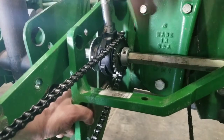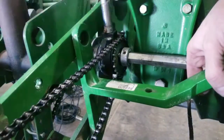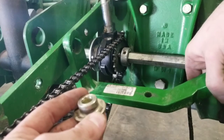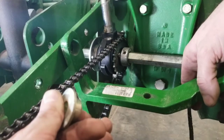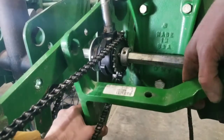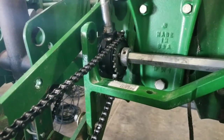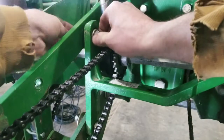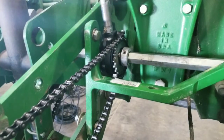Run that through the hole in the parallel arm. When you took your springs off, you've got a pile of these. I think there was probably supposed to be a helper spring at some point on this kit — I'm not going to use that, but I am going to keep one of these on the bottom one at least, because it works as a washer-spacer combo since these bolts are too long. Put that on there, bushing and bigger bolt, and tighten all that down.